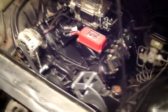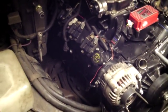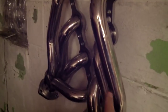Then finally the exhaust. Alternator's wired up. I got my eBay Chinesium headers hanging. Not a fan of headers, but they fit pretty good — I'm going to have a fitment video coming up. Passenger side fits nice. Driver's side, I'm having issues with the collector banging the frame, so I need to figure out a solution for that. It's going to go headers into a 2.5-inch pipe into a 3-inch single.